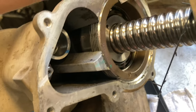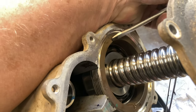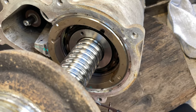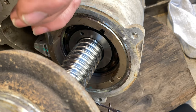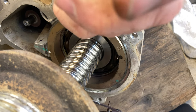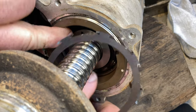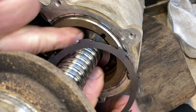You've got two notches in that nut. None of our spanners would fit it, so I'm just going to take a screwdriver and tap that thing out. Be careful — don't knock a bunch of crap off in there and get it in that bearing. Take a hammer and just tap that out. Doesn't take much. You've just got to get the pressure from the preload off that bearing, and then just turn it out.